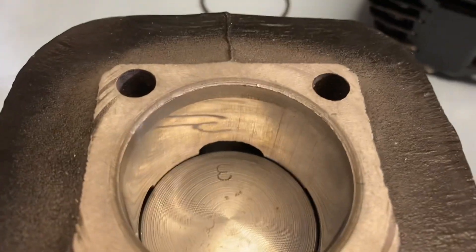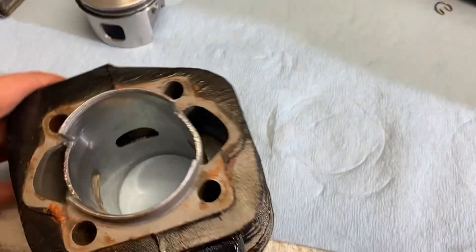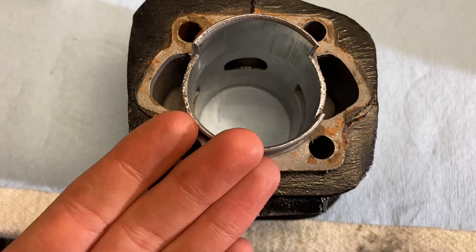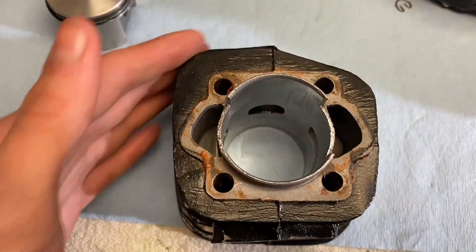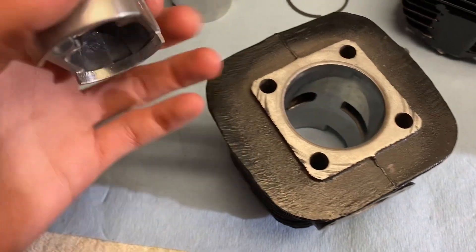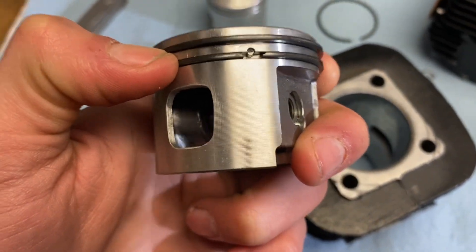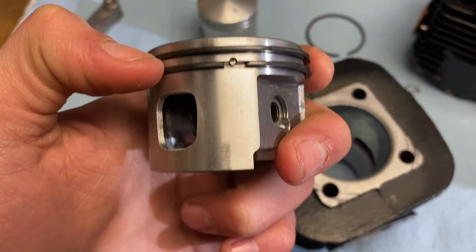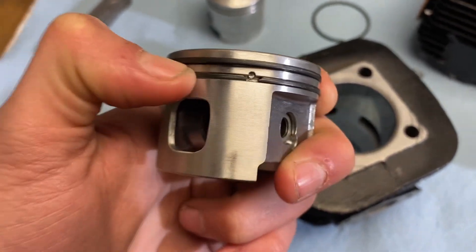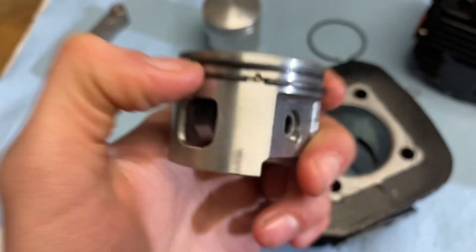If you think about it, the exhaust side of your motor is always going to be hotter than the intake side. You'll notice that the transfer ports point towards the intake to keep that intake charge towards the back to keep the back of the engine cool, whereas the front of the motor is air cooled as well. The exhaust side is always going to be hotter. You'll notice that these ring gaps are very tiny, and when they're in the cylinder they're even more tiny. When the engine overheats, heat causes expansion, and expansion of the rings causes them to shrink up. The ring end gaps are going to close up to the point where, spinning over at 8,000 or 9,000 RPM, one of the rings will actually break off on you.